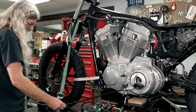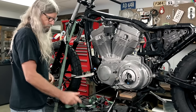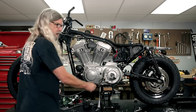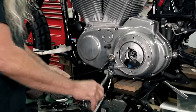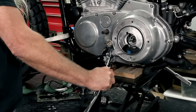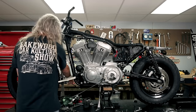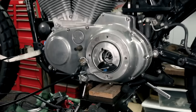There we go. Okay, now I think I said it when we were taking the cable off, but I'll say it again. Be careful tightening this because the threads are hollow. If you over tighten it, they break off. It needs to be just tight enough for it to seal. Like that, perfect. Okay, shove your cable up through so you got your end sticking out.